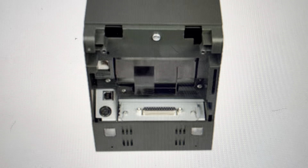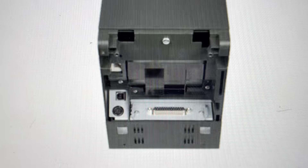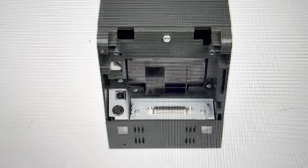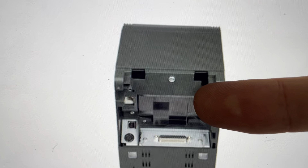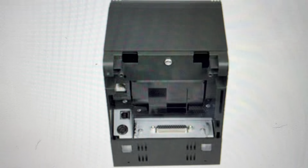What you'll need to do is get a paperclip or something to press the reset button, and then you're going to remove the buzzer from this area here. Just make sure you don't unplug it — it needs to stay plugged in, but you'll pull it out. When you pull this section out, right inside here you'll see a small reset button that you can press and hold for a couple of seconds, and that will initiate a hard reset to the factory default settings.